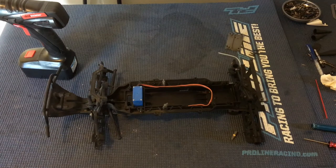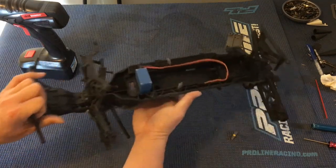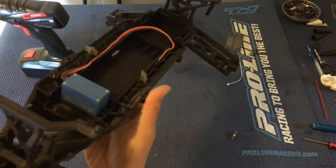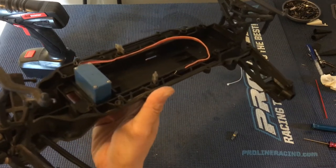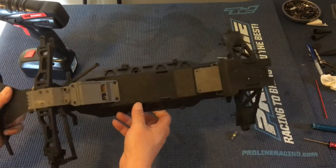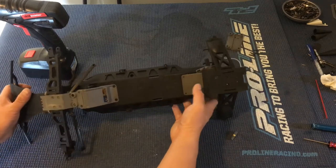We're going to be building this Ruckus to go all out, incorporating all of our learnings to build a brushless-powered, two-wheel drive, 1/10 scale Ruckus. I'm going to address the steering today — we did throw in a Savox servo. This is a 0231 MG — so a metal geared Savox servo that we had on hand. The stock servo, as is to be expected for a ready-to-run car, is not the best quality.